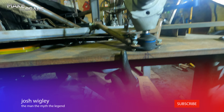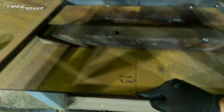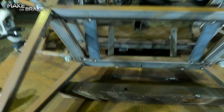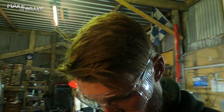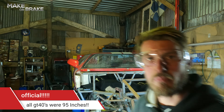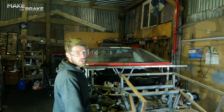It's all marked up. Before I turned the cameras on I marked the inside of this front chassis piece — it's 70mm from the front of the table. I've marked various other lines so I've got a reference point to where the front end was and I'll have a reference point shortly as to where the front end needs to be. The wheelbase — we have it under quite good authority now — is somewhere between 95 and 95.5 inches; 95.5 inches to be correct for a GT40, especially a Mark III. Our wheelbase is going to be pretty much bang on that, maybe a touch short, but at the end of the day it's a recreation so we have to go with the panels that we have.